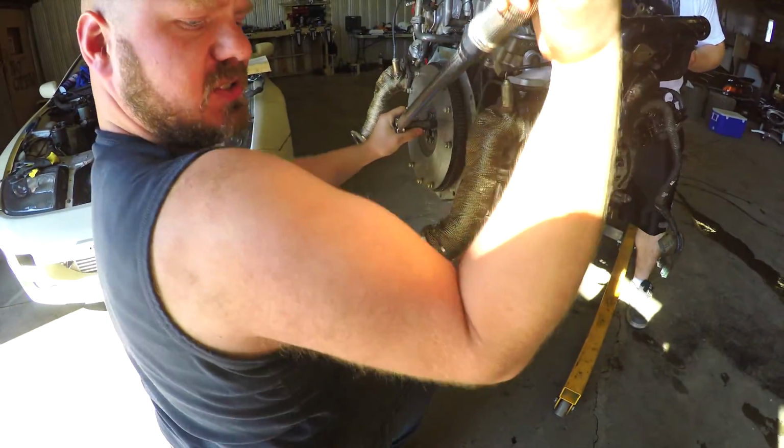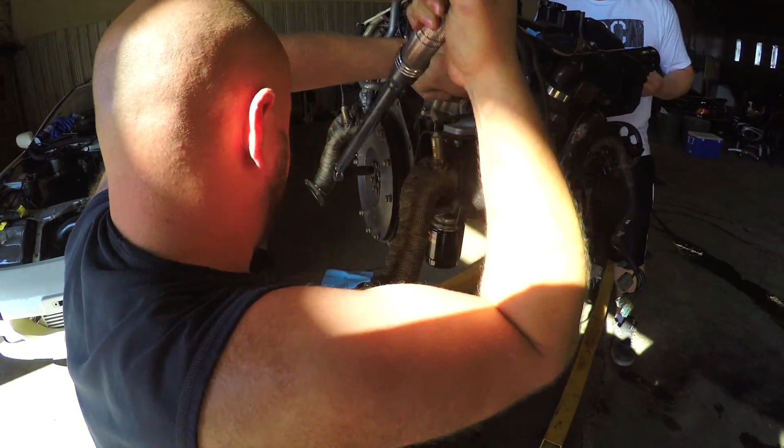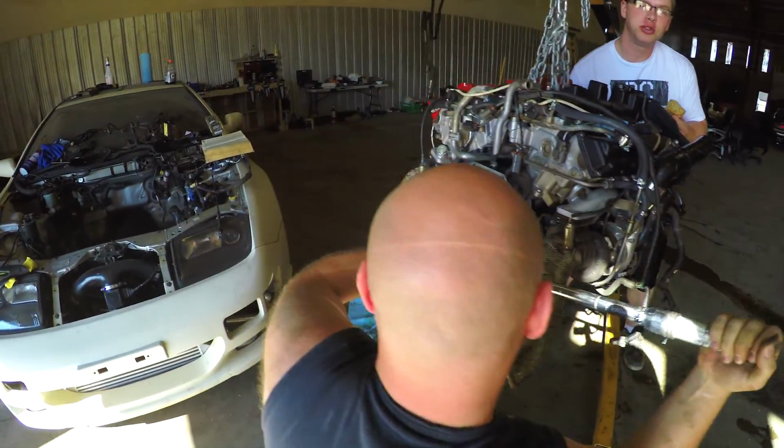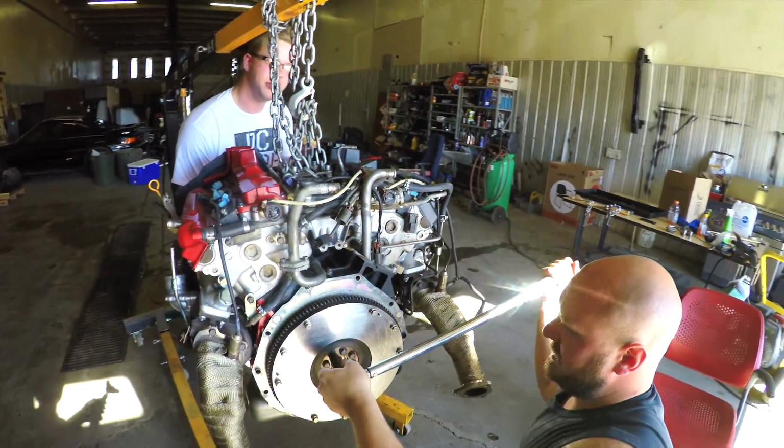Oh yeah. Torquing down the flywheel to 69 because Nissan said 61 to 69, so we thought we'd choose 69 because it's funnier. And it's always a good time.